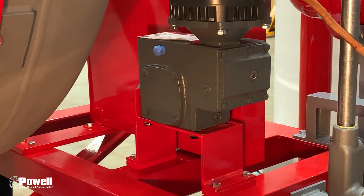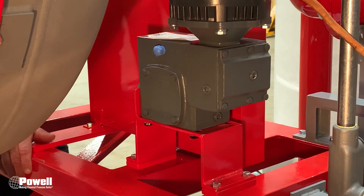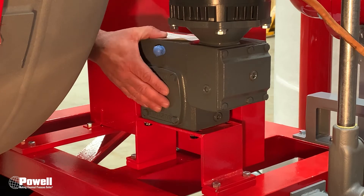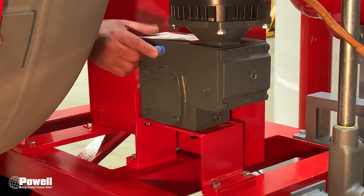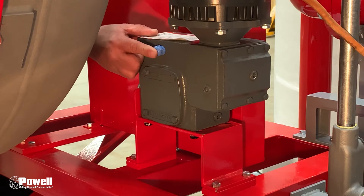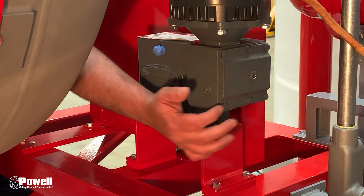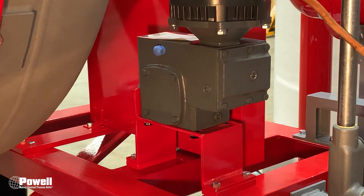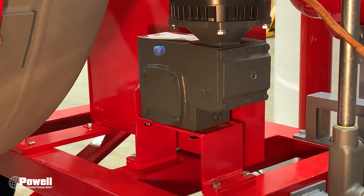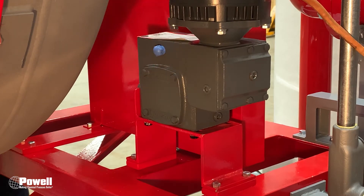The amount of oil depends on the gearbox in use. Add the oil slowly to the lower chamber — remember, that's this port right here — and add oil until it comes out of this port right here. Remember, it also takes quite some time for the oil to get from one chamber to the next because of that bearing.